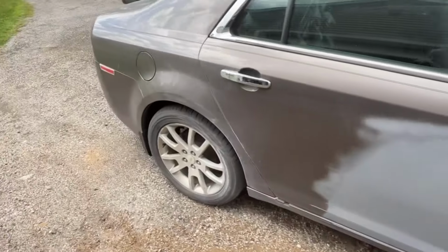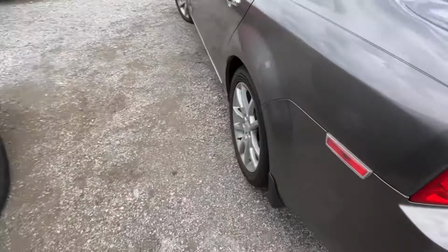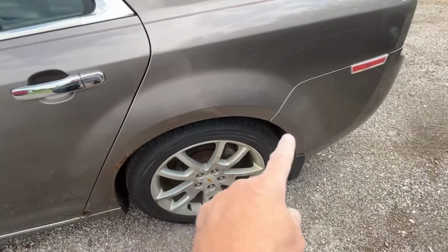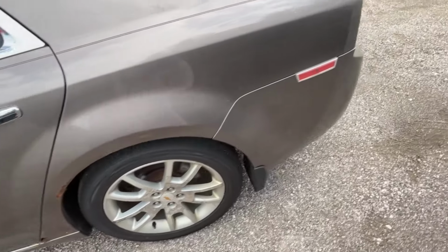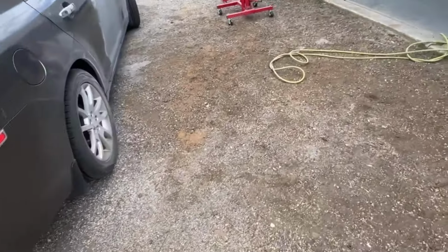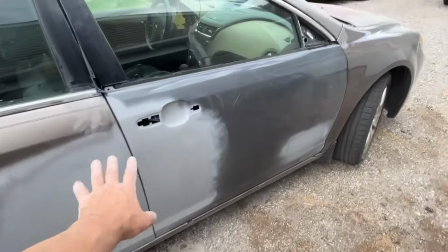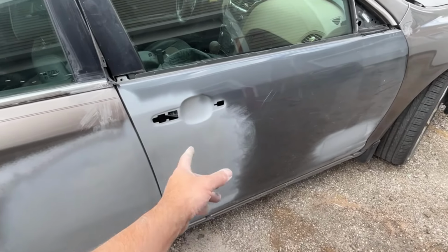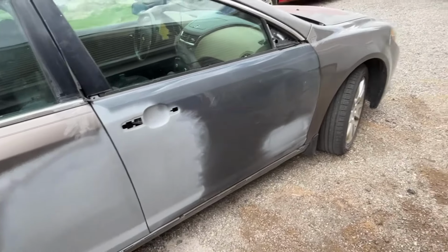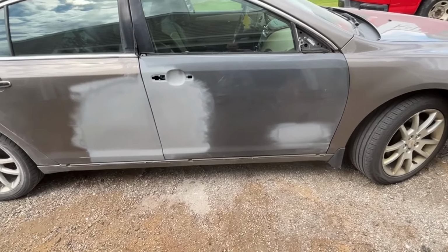So, all right guys, that's gonna end this video. Next video, we will be fixing the rust on this side. So basically by the end of day tomorrow, all this rust needs to be fixed, and this car needs to be in 2K primer. Because then after that, the next step is paint. And once it's 2K primered, maybe tomorrow night I'll take this door off and paint the jamb and bake it and put it back on the car. And at least that way, we're good to go for the following day to paint it.